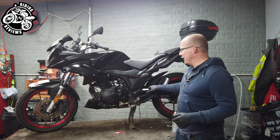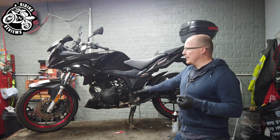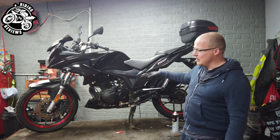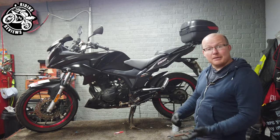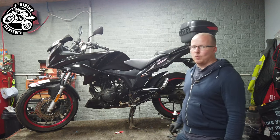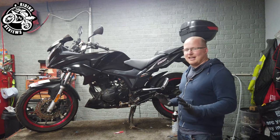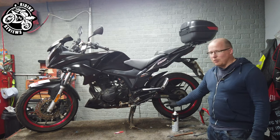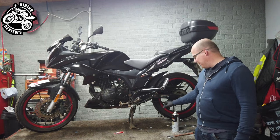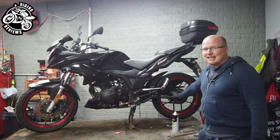Next: jet washing your bike. In theory, you can jet wash your bike as long as you're standing about a meter away and always wash downward. But it's best to just get a bucket and a sponge and go over everything — you can use a brush for the detailing. If you pressure wash upward, I guarantee you're going to have wiring issues. Even washing downward there's still a chance. On the whole, try and avoid it. Also, don't jet wash your chain because you'll wash all the grease out, the inner parts will dry out and start corroding and getting stuck in weird positions — and that's not going to do anybody any good.